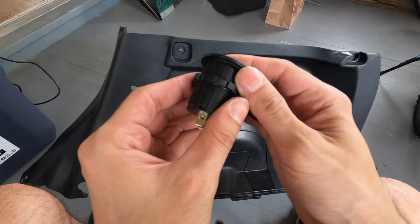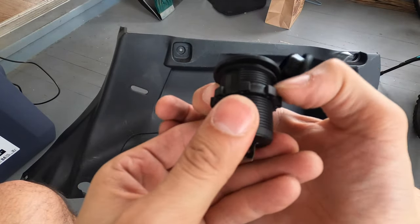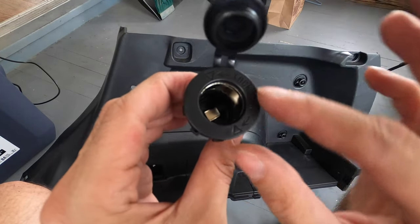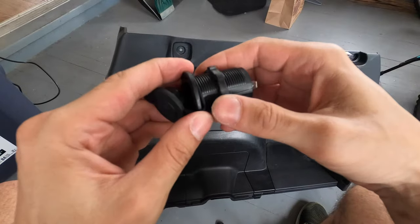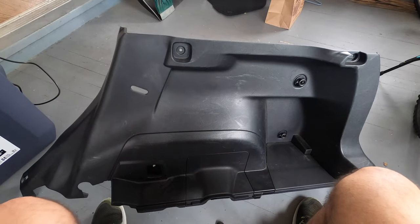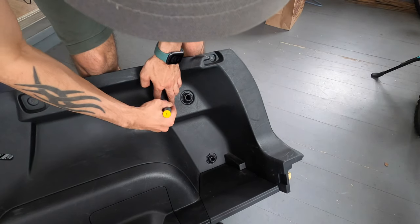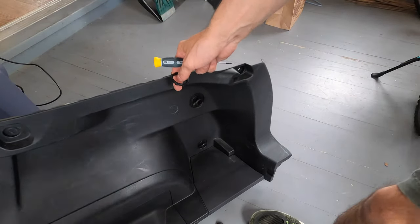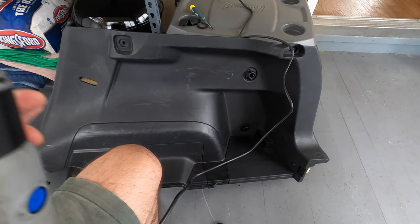When installing this, you can see that the lip is wider than the actual socket itself. So we want to make sure that we drill a hole that is not as wide as the lip, but just wide enough to fit the socket. I'll show you a little trick for doing this: unscrew the plastic bolt or washer, get a screwdriver, line it up where you want it, and just trace the inside. That is where you are going to cut. It's not super thick, so you might even get away with just a razor, but the Dremel is definitely going to make it easier.